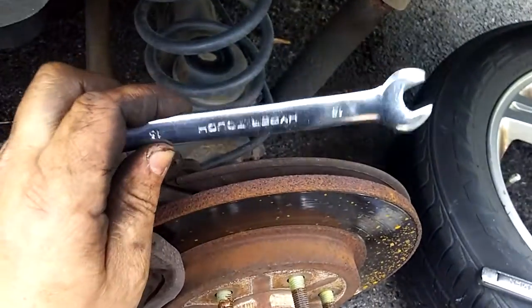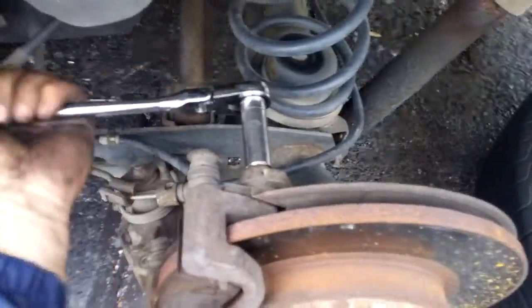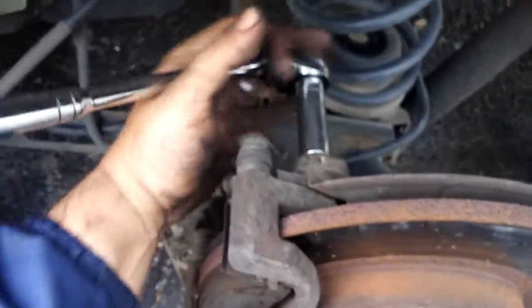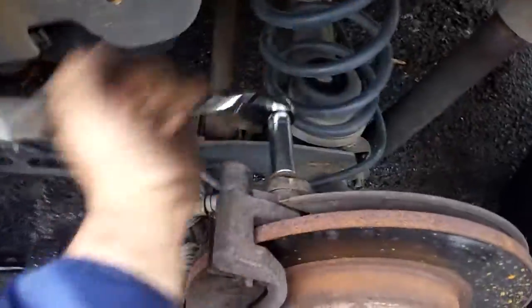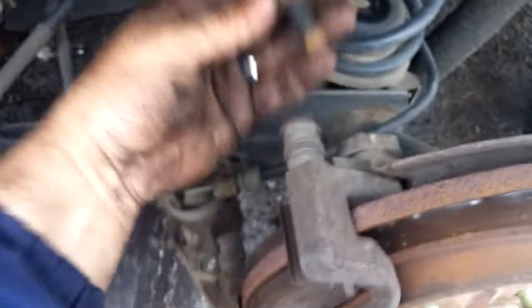Now as far as the caliper bracket housing right here, I've got a 15 millimeter wrench — nothing fancy, a little Hyper Tough banger wrench from Walmart. I'm going to put it on here and tap it with a little ball-peen hammer so it can loosen up for me and make it a lot easier on my ratchets. Then once they are loosened up with the wrench, I'll stick my ratchet and socket on here and get it off with ease. Subscribe to my channel — I do tool reviews and do-it-yourself repair videos.